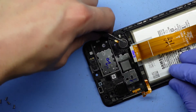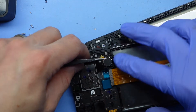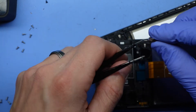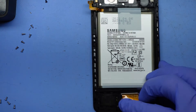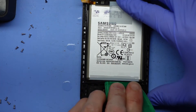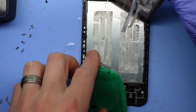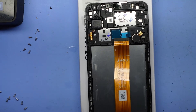To begin with I'll take out the vibrating motor — lift it up and out, perfectly fine, and drop it in. It did take the adhesive with it but it's not very sticky, so I'll bend this bit down and put it back in. Next up I want to remove the battery, so I'm going to use some isopropyl alcohol along here and up here, give it a second, and then I should be able to pry that out. There we go — I will have to replace the adhesive on that. That's now alright to move out of the way.